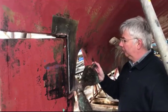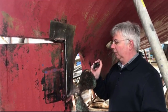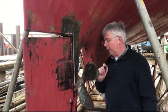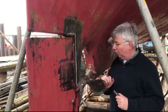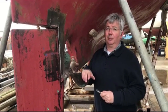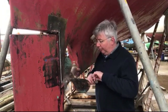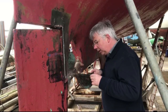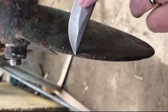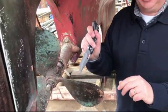I'm going to see what the propeller's like. A little bit dull. The edges of the propeller are actually coming away and just the light tapping I'm doing with this knife is putting dents in it, so the propeller is de-zincified — the zinc is coming out of the metal. It's bronze, but bronze contains some zinc. I can see the propeller is quite pink, which means the zinc is coming out of the metal due to de-zincification, so the propeller itself is becoming an anode.